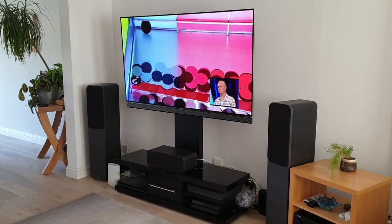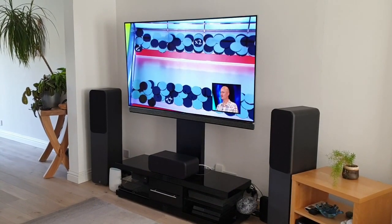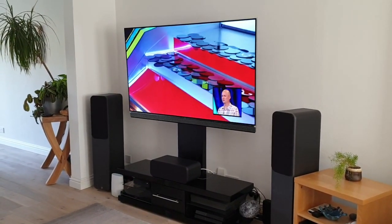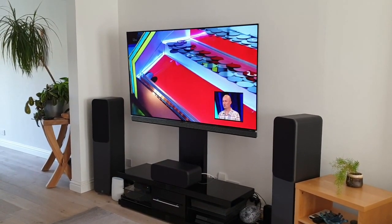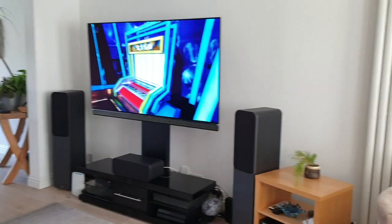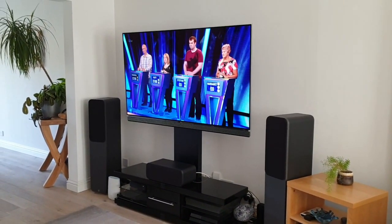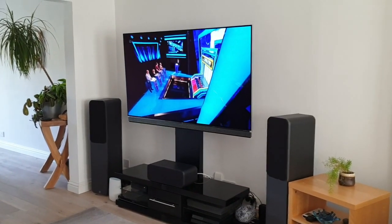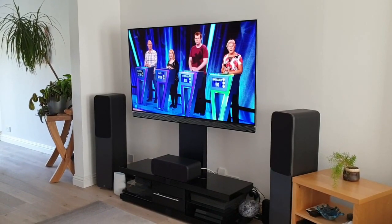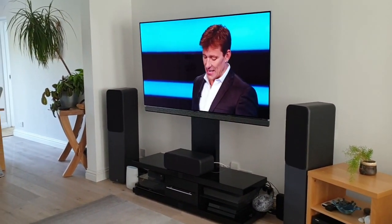This video will show you how to get a Ring doorbell to show on a TV using an automation, an Amazon Fire 4K stick, and an Echo Dot alongside a Sonos speaker. Effectively it will switch the source to the Amazon Fire. A SmartThings routine will use the Sonos speaker to ask the Echo Dot to show the front door, timing out after about 25 seconds before switching back to the TV.